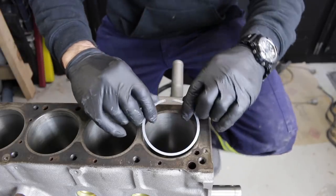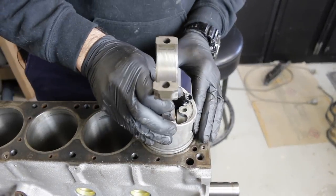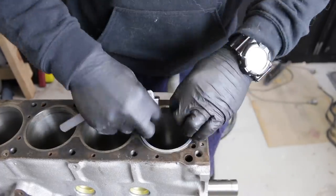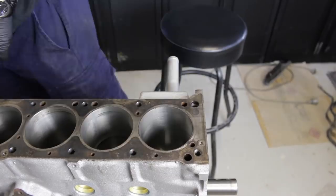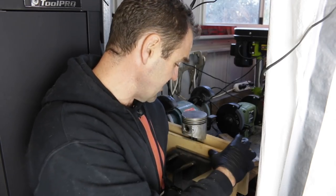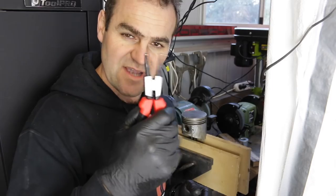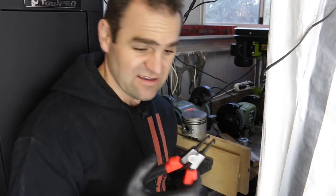My next job is to measure ring gaps. Measuring ring gap means putting the rings into the block, then using the piston to slide them down inside the block about three inches, and then running through with a feeler gauge. All the rings gapped out nicely, and now I've got the pistons. I've got them clamped in the vise between a couple of bits of wood just to keep them still while I install the rings. I don't actually have a proper ring expander, but I've done one already just using a pair of circlip pliers and they make it a lot easier.